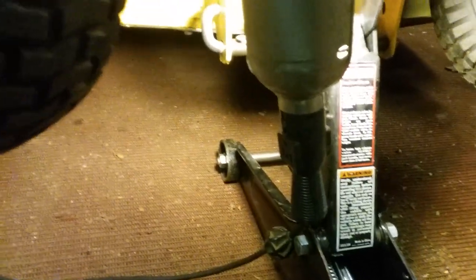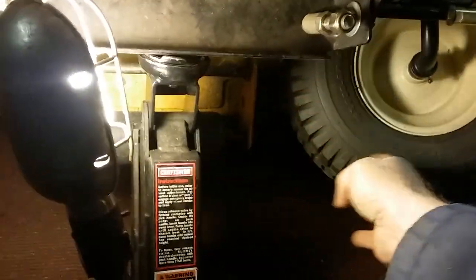Right there is the inch and three quarters, and that's why you turn the wheels where you can see that. Come back and measure your other side — take your wheels and turn them back around the other way. Stay from under your lawn mower. The bumper here is high off the ground but I've got it jacked up pretty good. I didn't want to use jack stands, but I've got enough sense to stay out from under it. If you put a jack stand there you don't have enough room to turn your wheels. Just stay out from under the thing — it's not that heavy but you don't want to hurt yourself.